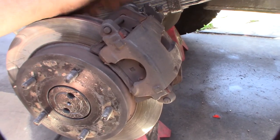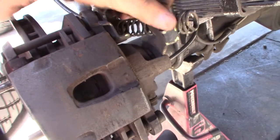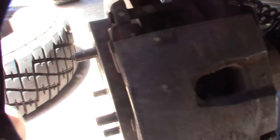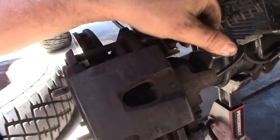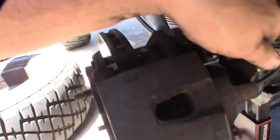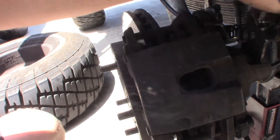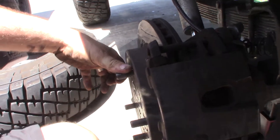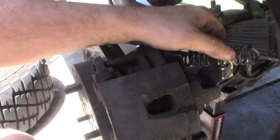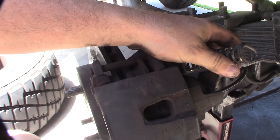I'm gonna get this caliper off, release the e-brake, and see if I can get the thing adjusted. I removed the cable and spring — see how this thing goes up? When pulled forward, it's supposed to hook up and put tension on the caliper to squeeze it. There's a little threaded screw inside the piston. Right now it feels tight, but I'm just wondering why I'm not getting enough tension to stop the car. I'm going to check the other side.